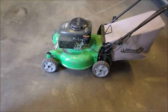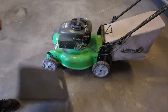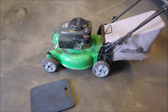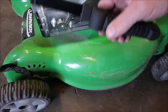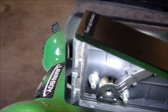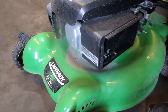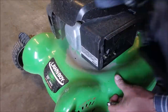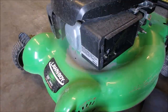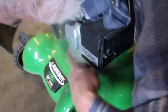I'm going to get my protection - always carry protection. I got a new light. If you can see in there - that choke is closed. We've got a couple of things we can do here. We'll grab a 10mm wrench and see if we can get at the drain of the carburetor. It doesn't mean anything if the gas spurts out of here - it just says the gas line to the carburetor is not plugged.